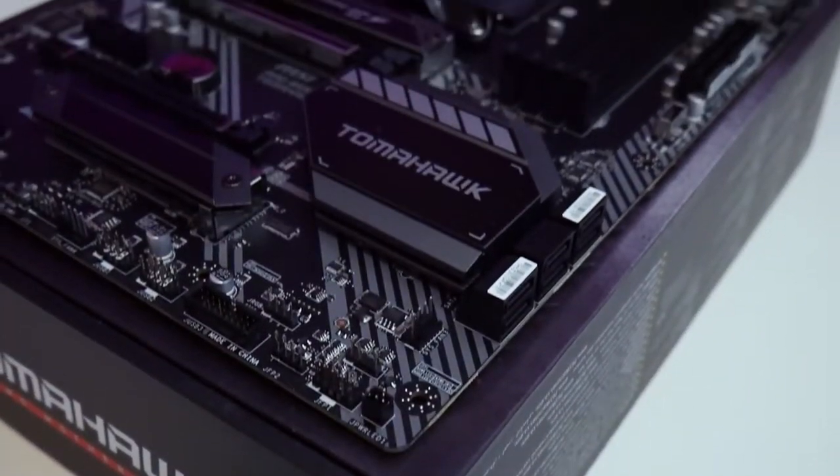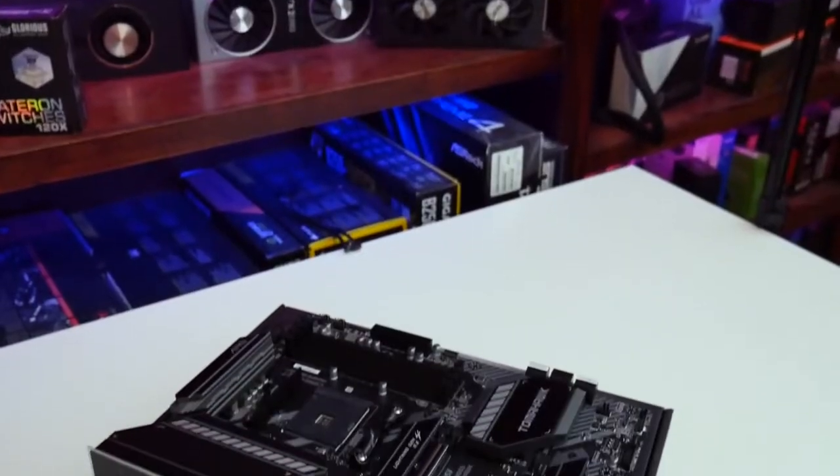You have 6 SATA 3 ports. This is kind of going the way of the dinosaur. I do understand that a lot of people want to use SATA still, and there are devices that you want to plug up in that manner. That being said, 6 seems a little bit extensive, but of course having more is never a bad thing. I don't see a reason for using 6, especially because this motherboard only supports RAID 1, RAID 0, and RAID 10. So it's not like it has an onboard RAID controller where you're going to be setting up some sort of a storage system, a SAN or a network attached storage or anything like that. Since you aren't going to be doing that with this system because of the limitation on the RAID, of course, unless you did a PCI Express slot to handle your RAID for a RAID controller, I'm not quite certain that you really need all 6 SATA 3s.